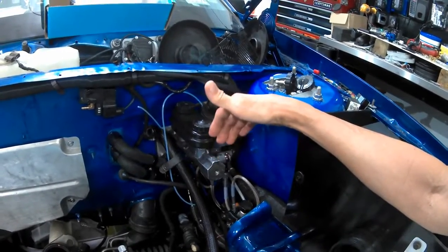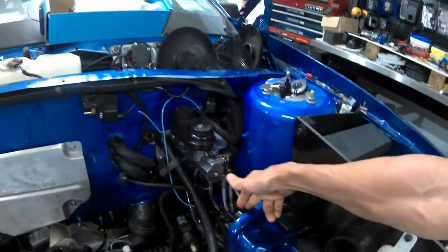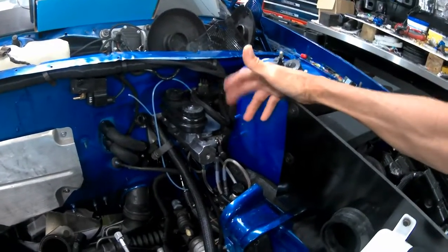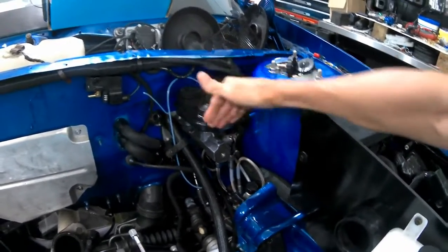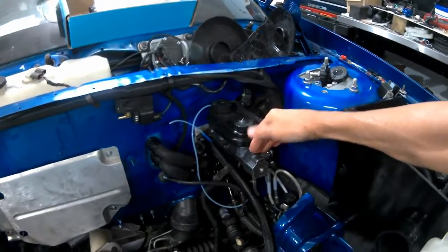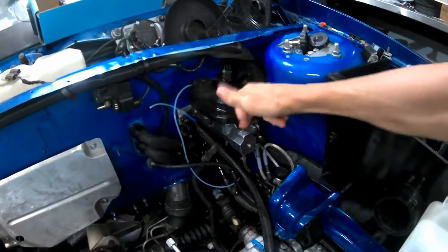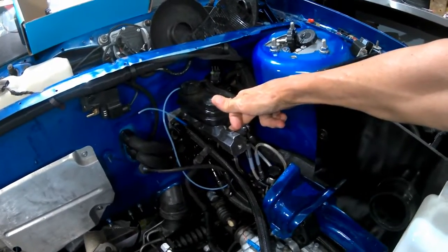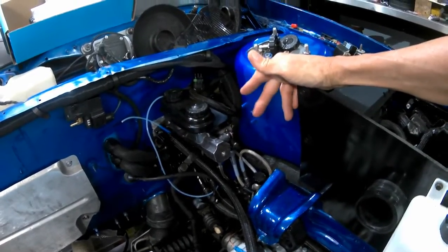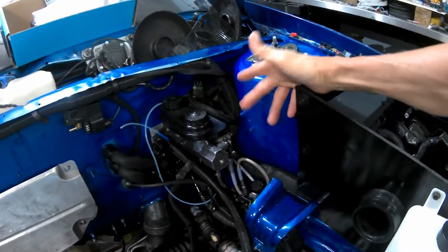So the way I'm using it, with this adjustable proportioning valve, half is going to go to the front and half is going to go to the rear, so I don't think it makes a difference as to which half you're using for which. The front half of the master cylinder is called the primary, the back half is the secondary. I'm going to make the front half for the front brakes and the rear for the rears, mainly because it's a lot easier to keep track of — I think the front's the front and the back's the back.